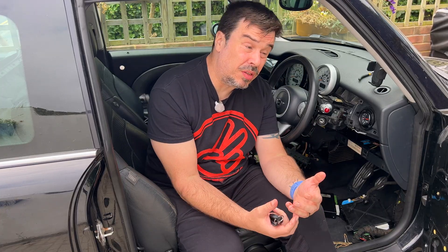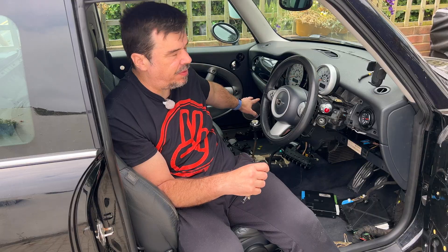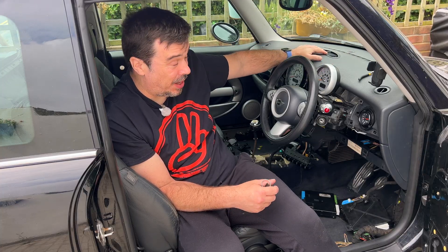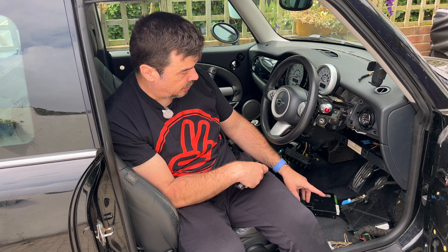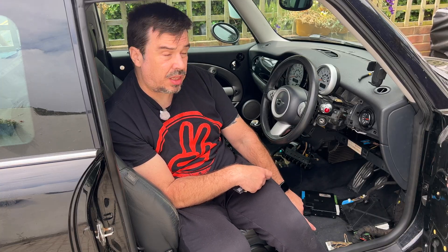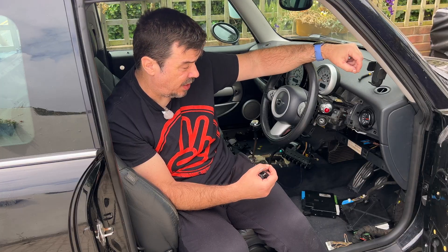All of this takes a few seconds to talk through, but for me it's actually been two and a half days to get to this point. There's been a lot of fault finding using a multimeter - I went through every single fuse in that side panel, and my entire dash got ripped apart tracing a BCM wire connection I didn't need to worry about. If you're fault finding issues on these Minis with intermittent lights inside, first check the BCM - just play around with the plugs - but then go straight to the junction modules and start unplugging things. If I had done that to begin with I wouldn't have had to rip anything out of the car except for this one side panel.